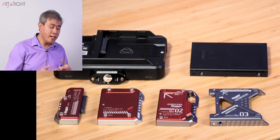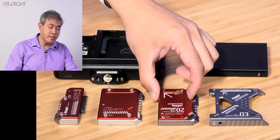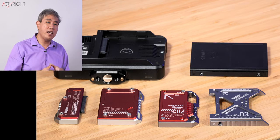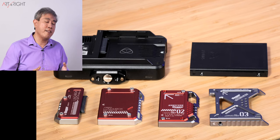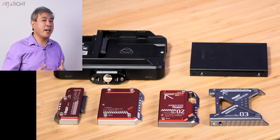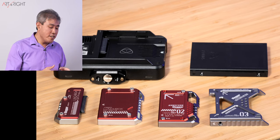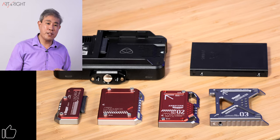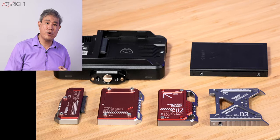This is a good novel idea; however, the moment you take a drive apart, you are voiding the warranty on that drive. Enter the second generation Lunchbox, which is compatible with a few Samsung drives — the 870 and also the 860 EVO and QVO in one and two terabyte capacities. I'm not sure if other capacities or other Samsung drives will work, but these are the ones they've recommended on their website. The caution for the second generation Lunchbox is very similar to the first: if you take apart a Samsung drive to put the internal SSD into this device, the moment you do that, you are voiding the warranty on the original drive.